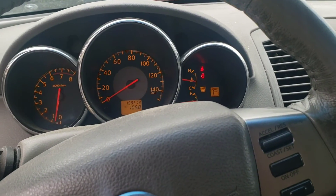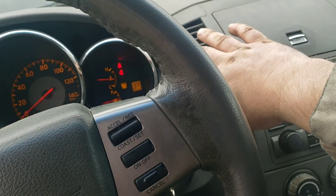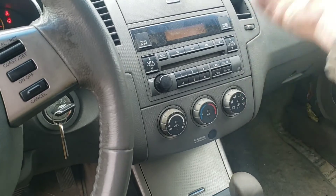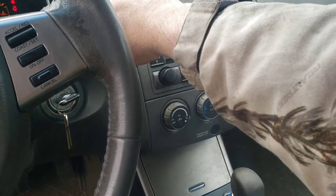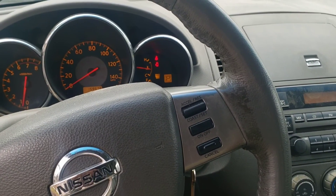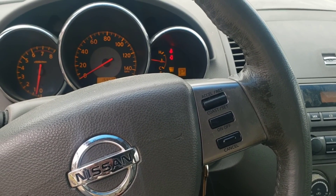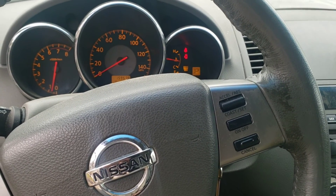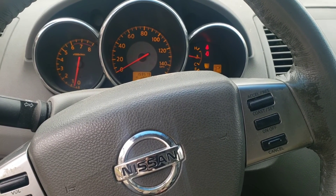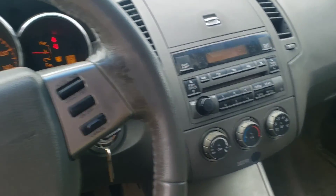Another way to test it — once you're at full operating temp, if you previously had good heat and didn't have any issues, then it should blow hot. Right now it's not, so that means there's still air in the system, because the coolant is not getting to the heater core, which is what the air blows over. The heater core gets hot from the coolant — that's how you get heat. Right now we're dead cold, so there's still air in the system and there's no coolant going to the heater core. I definitely have air — I had heat prior to this, currently I have no heat, so there's definitely air in the system still.